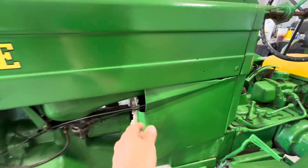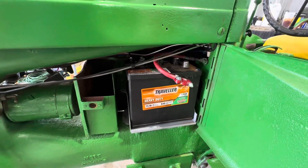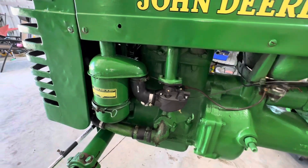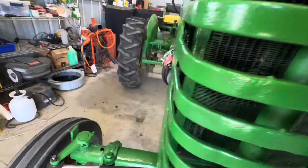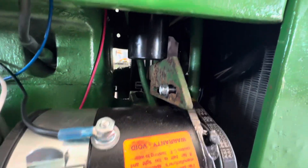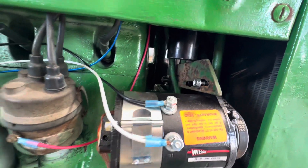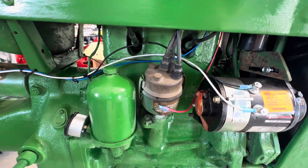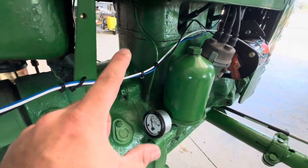All new terminals, new battery tray, new battery, new carburetor — the one that was on there was pitted. There's no air filter in this; it's actually just oil. A new generator, had to get a new fan back there if you can see that. Replaced that, replaced the ignition coil. The distributor was fine but the points were pitted, had to replace those, and then all the gauges were shot.